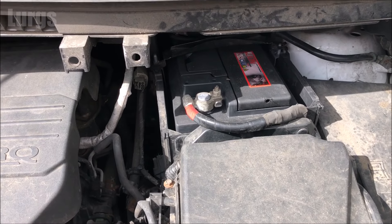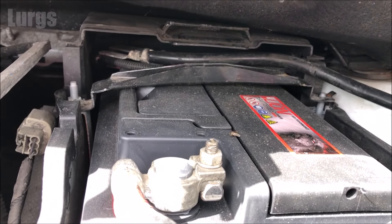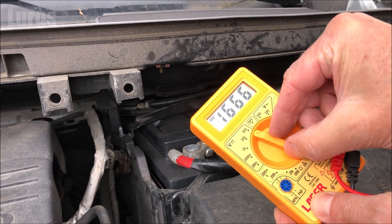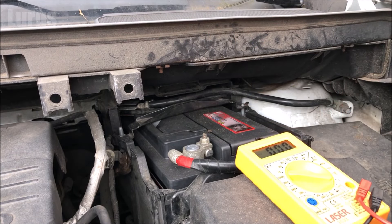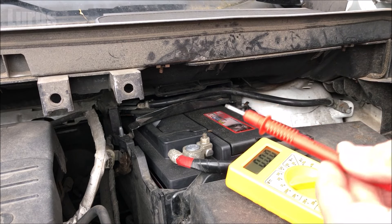This is very tricky if you ever want to remove and replace this battery. Do a quick visual check on the battery terminals for any corrosion. This particular battery is in good condition, but let's go ahead and test it. Take your digital multimeter and set it to the 20-volt setting, because it's a 12-volt battery and that's the nearest voltage.